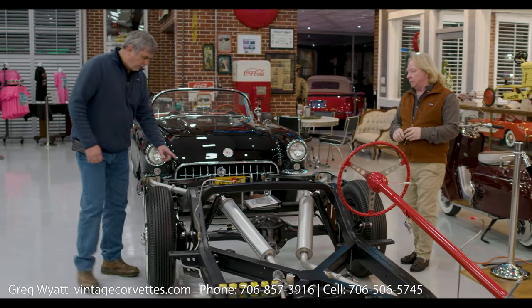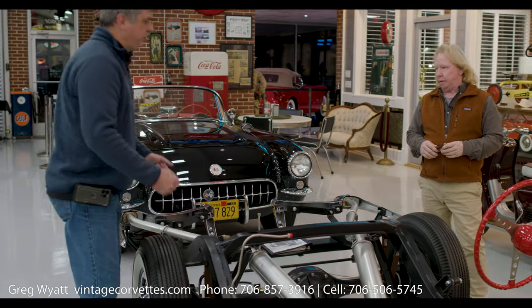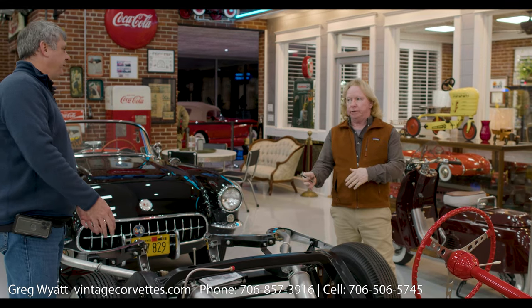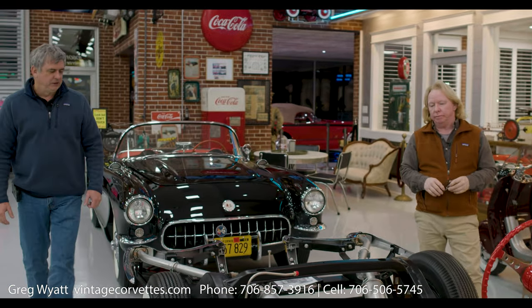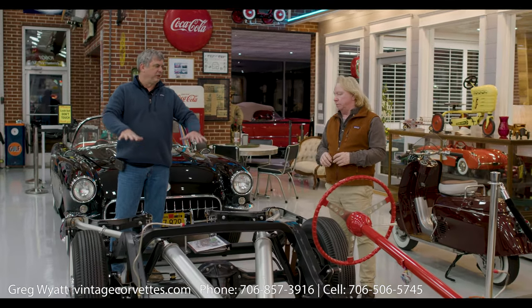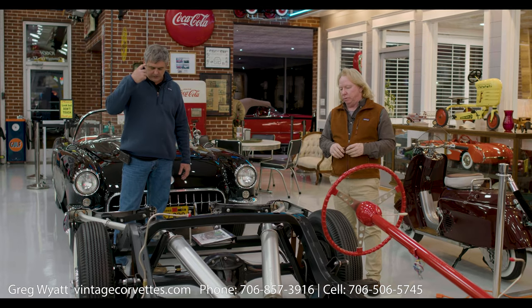Right now the car is unloaded with the body, so it's tied against these straps. So when the car was jacked up by the frame, it would bring the axle with it — it'd catch the rear end without hanging on the shock. Here they're completely under tension because there's no weight to offset the spring rate.